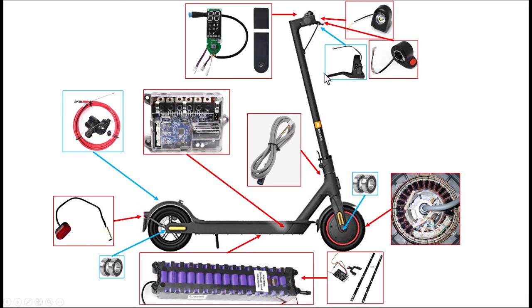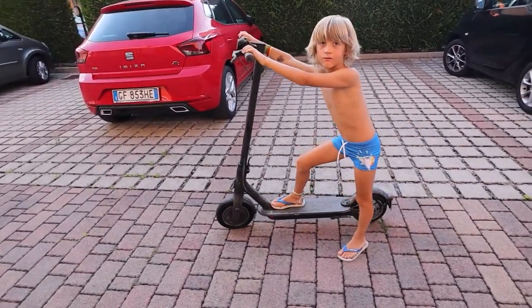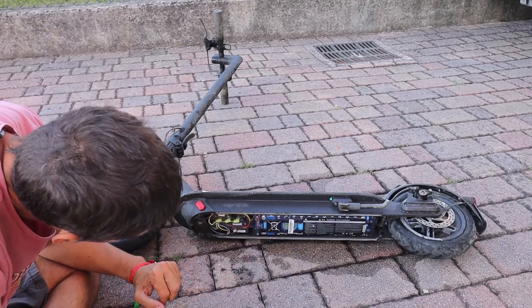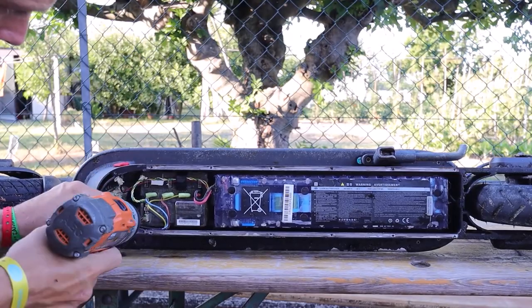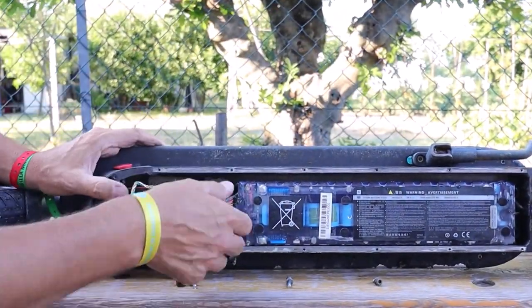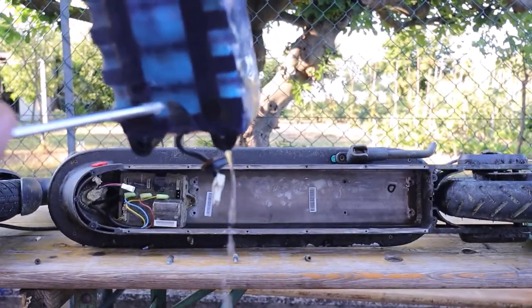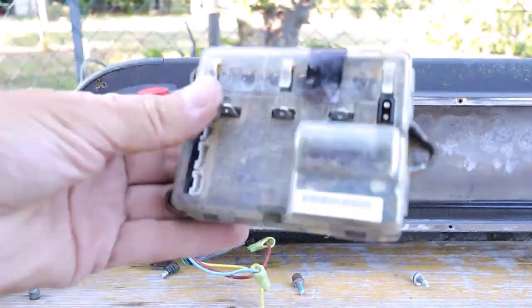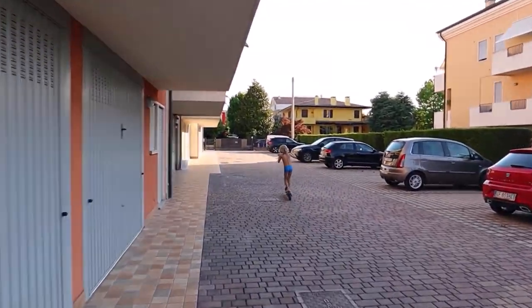How many parts survived after one year under water? Let's see. I noticed that the motor was offering viscous braking, which means high friction at high speed and almost no friction at low speed. This could mean a shorted motor or shorted speed controller. The battery and the electronic compartment was totally full of water. Now let's remove the speed controller and the battery. Disconnect the wiring going to the rear lights — the connector looks in good condition, actually, while the battery is full of water. To remove the Faston connectors, press strongly with the plier because there is a retention spring. It is running freely, which means that the motor is good and the speed controller is shorted.